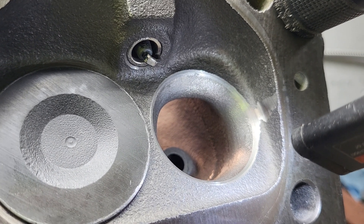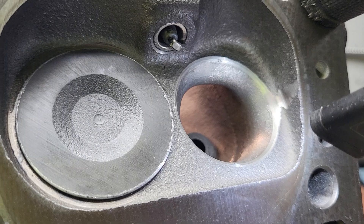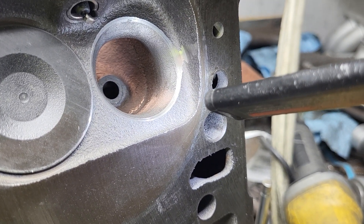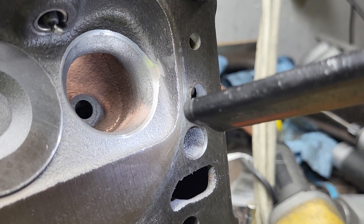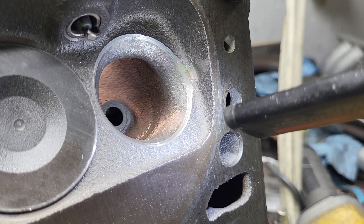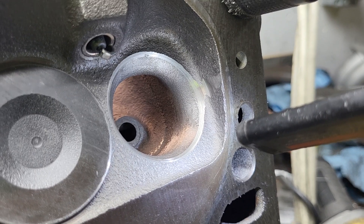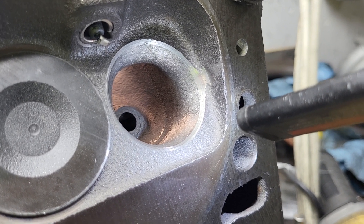So it's a little bit wider top to bottom than a 1.2 — we can measure that. From top to bottom you measure a 1.3. Now the 165s that I'm working on, they're about 1.3 all the way around, but it's a different shape to the exhaust port, so keep that in mind.